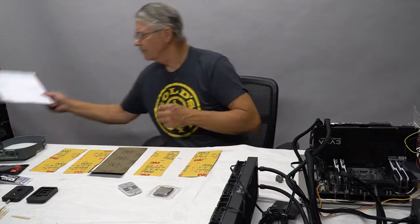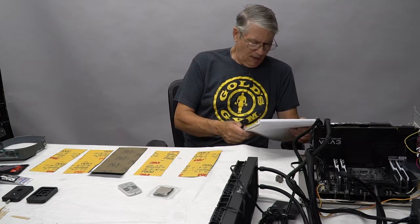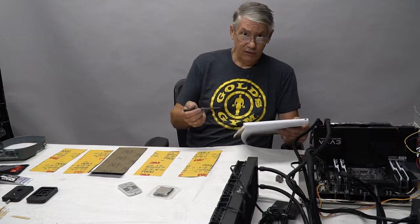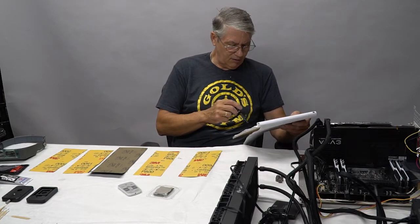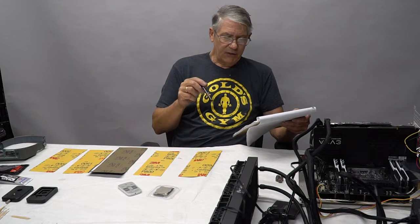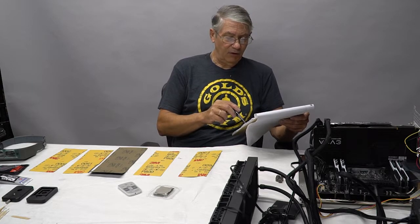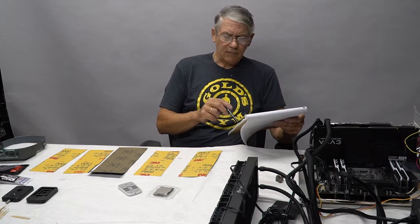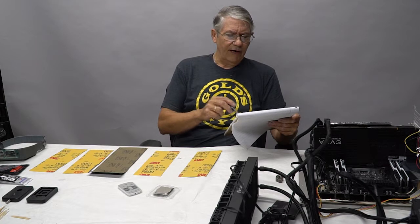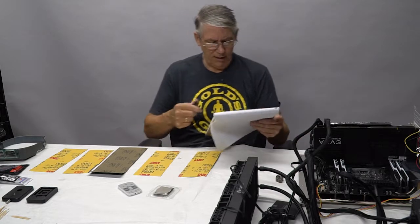So what we're finding, I'm running Cinebench and I'm running Blender as a couple of ways to get some constantly high temperatures in here. I've run the Intel Extreme Tuning Utility to get an idea also of my temperatures, and Hardware Monitor. So even at stock speeds out of the box, this CPU is idling in the high 40s. I'm getting temperatures at 100% of as high as 83 degrees Celsius with a VRM temperature of 60 degrees. And that's running at 3.8 gigahertz. If I crank this thing up to 4.1, I am then getting temperatures of 98 degrees Celsius, which is way too high, so I don't even bother running it through.